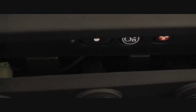Sorry, the lighting is horrible — I don't know how good that's gonna come out. There's a clip for the cigarette lighter right here and it hits the bottom of the OnStar unit when you try to pull it out. So it's pretty challenging but it can be done; otherwise you have to remove this whole piece.